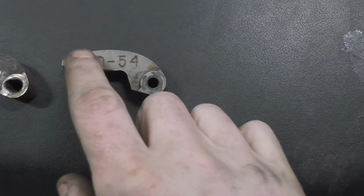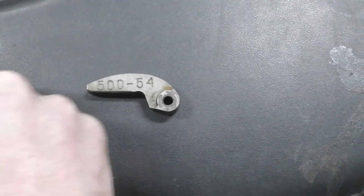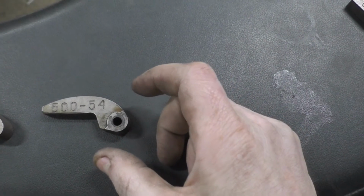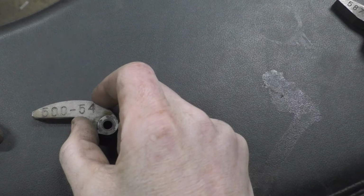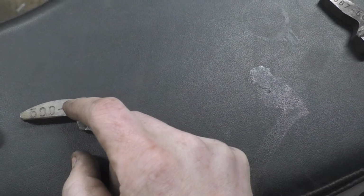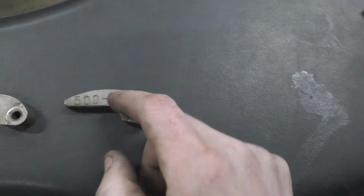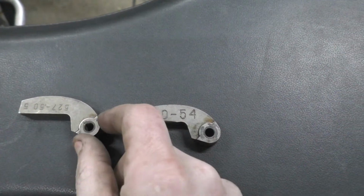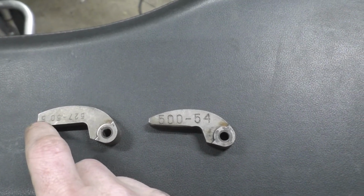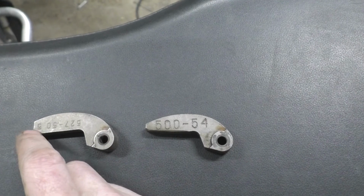And they're heavier on the heel and lighter on the tip, which I don't really care for. Especially on this 600, with not a whole lot of bottom end power, it's going to want to shift out so early, because the heavier heel will cause it to try to shift up the primary sooner in the RPM range. So I put weights like this one, only 47s, that have the heavier tip, to where it has higher shift force at the end of the RPM range, which is where this engine makes all its power.